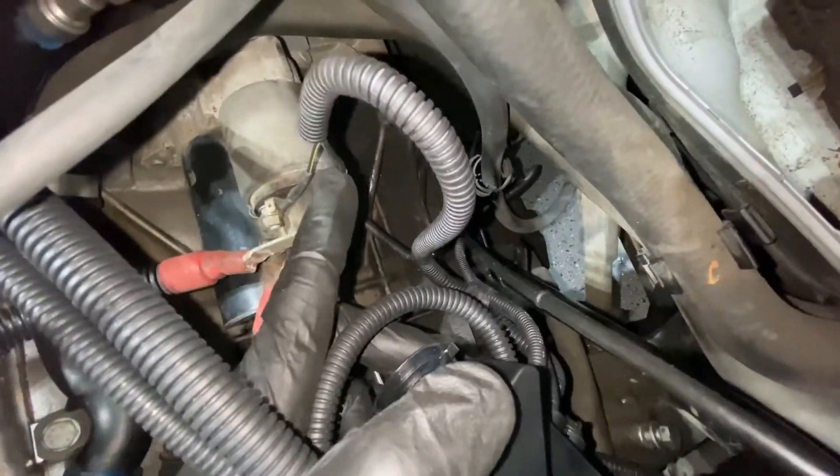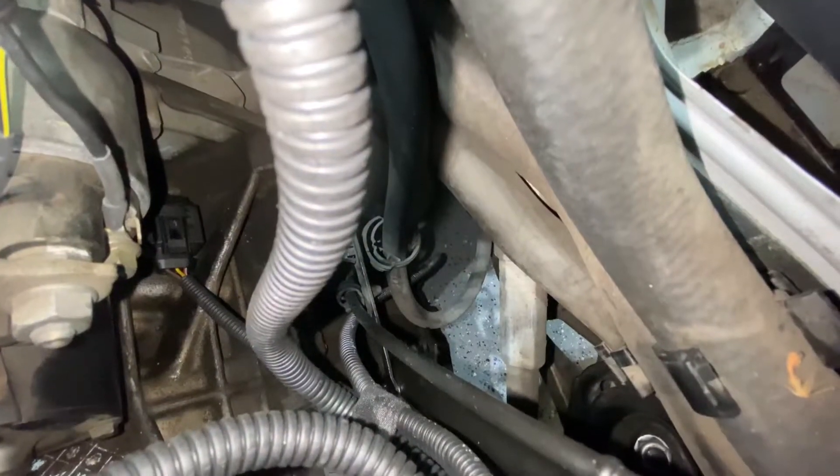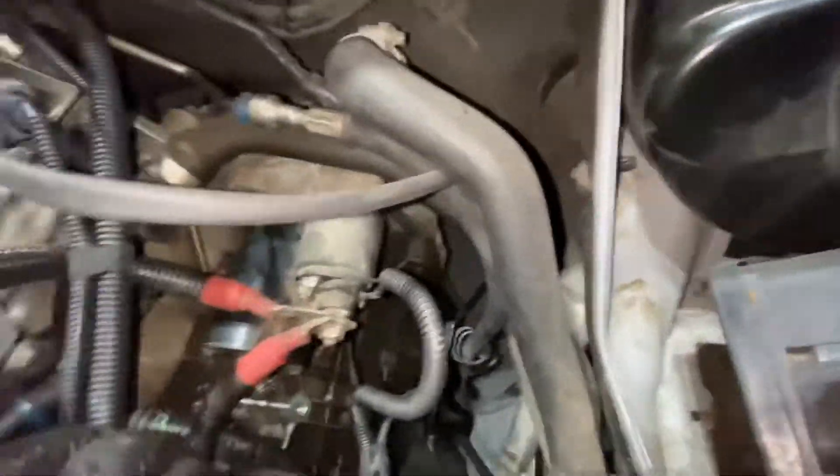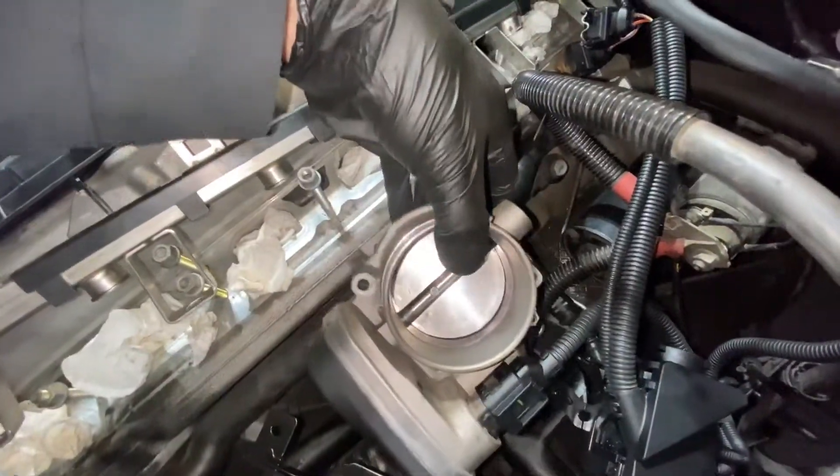So what kind of wiring do we have? You have four underneath this section of the wiring harness. One of them splits into two grounds right here, so that's one. The second one goes all the way down to the oil pan. Number three goes way under here — I can only see it because I took off the exhaust canister controller, which is not doing anything anymore since none of the other hardware is plugged in. Number four will eventually go back on to your throttle body.